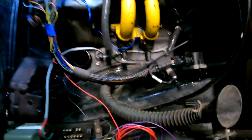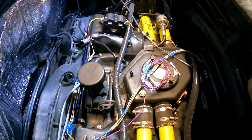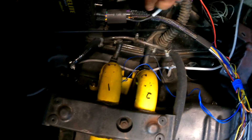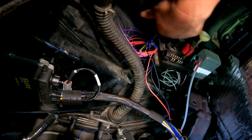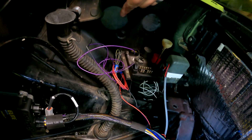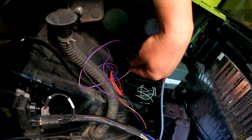Let me overview this as best as possible. I've got my ECU and ECU connector, and I've divided everything into the branches it's going to be in. Now this isn't everything — I don't have the power wires for the injectors, and I don't exactly know where my idle air controller is going to go. Starting at the ECU, this is the CAN connector. There's going to be a branch towards the relay board for power in, a fuel pump trigger, and this purple wire is the computer output of the tach signal. I need to use a tach signal conditioner, and that's going to input back into my main connection on the relay board from the stock system — basically making the digital output of the computer look like a negative coil tach signal.